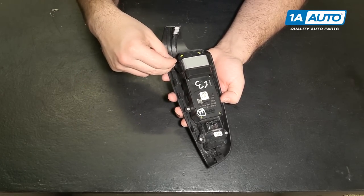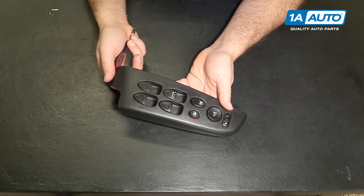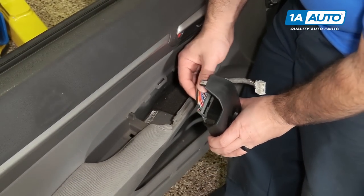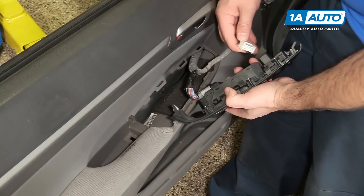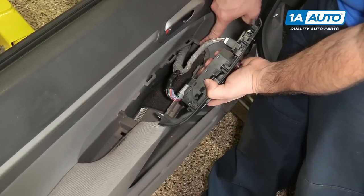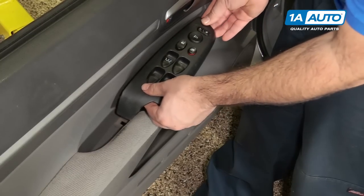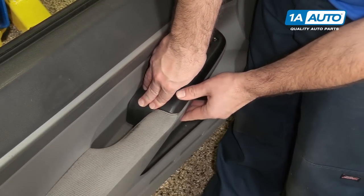The other doors are similar — it'd just be a single switch into the trim panel. When it's ready to go back in the car, plug the large connector back in place and it'll click when it's locked in. Plug the small white connector in here — it'll also click. There's a tab that's going to fit into the door panel on this side first, then a clip that's going to clip down into the door panel. Start by fitting it this way and then pushing it down into the door panel.